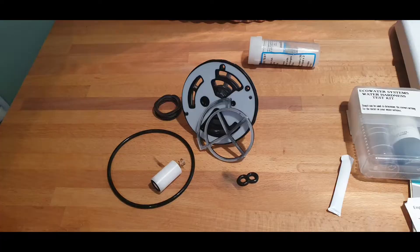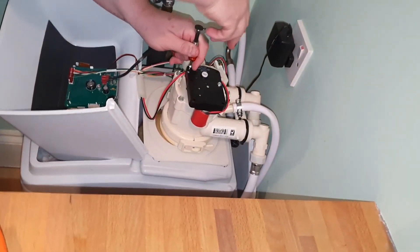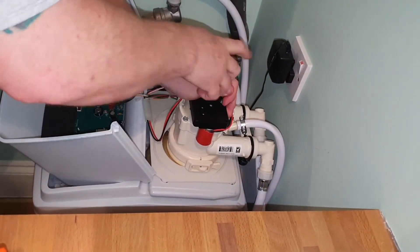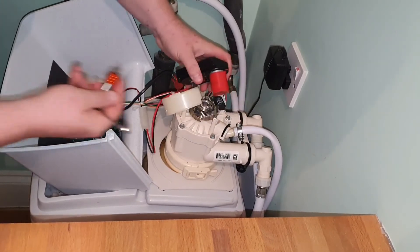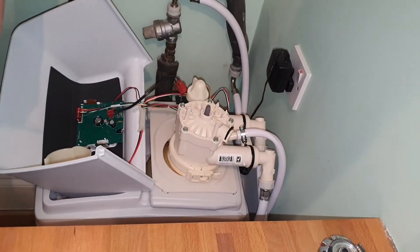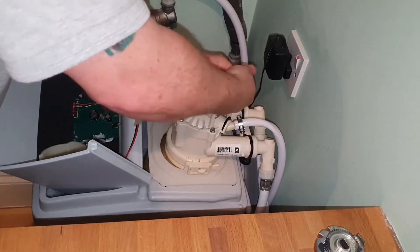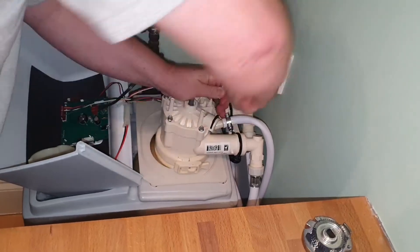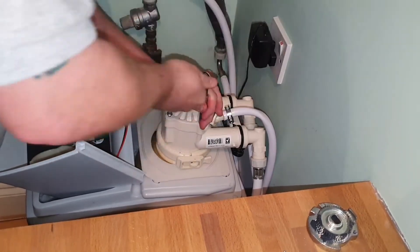This is the plunger — it's got a spring on it and an o-ring on the top. Using a Phillips screwdriver, we'll take off the two bolts which hold the motor down. This is a DC motor, and once those two bolts are removed you can take away the motor and also the cam gear housing all in one. Underneath it exposes the micro switch and the cam. Using a nut driver — I use a ratchet rather than an electric one because you get to feel how the bolt is when it's undoing. Remove all five of these bolts, and the key is to make sure the pressure's taken out by turning the cam before you take it off.